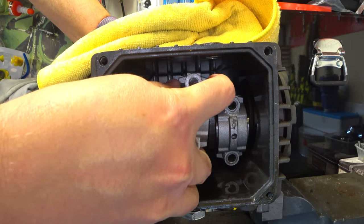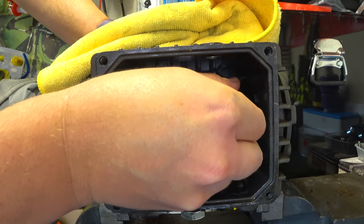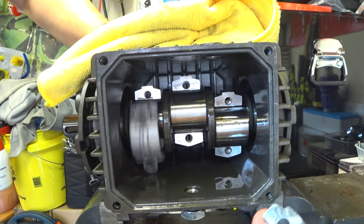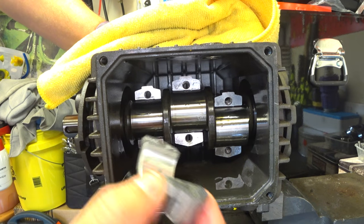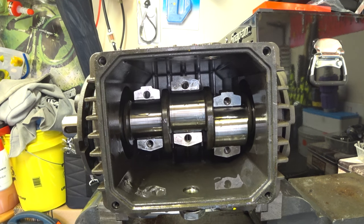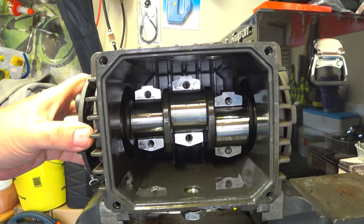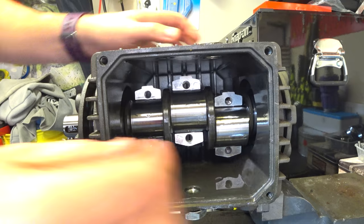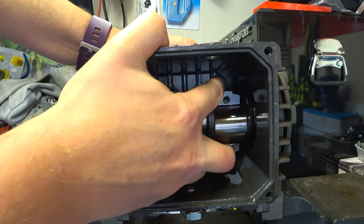Let's see if these caps are going to come off. There may be some dowel pins. No, no dowel pins. So number two, number three. And they run straight - there's no bearings on these. Obviously these are not high speed, so they're only running at about 1400 RPM. So in a car that would just be above idle at that kind of speed.